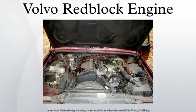The B204 was also available in turbo form in some markets where large displacement motors were taxed heavily. It came in two versions: the B204 GT turbo motor operates with a lead-resistant lambda probe and generates approximately 200 horsepower. The B204 FT uses a catalytic converter and generates 185 horsepower. Both were the first Red Block engines standard equipped with oil squirters for piston cooling, with crankshaft, connecting rods, and pistons all forged.